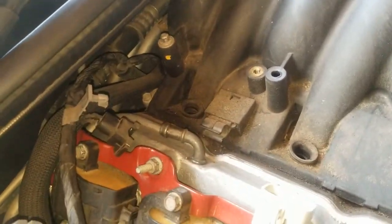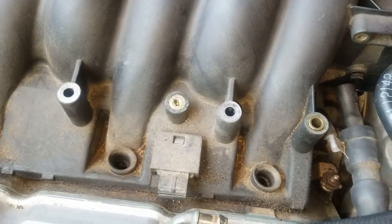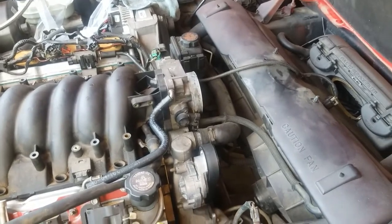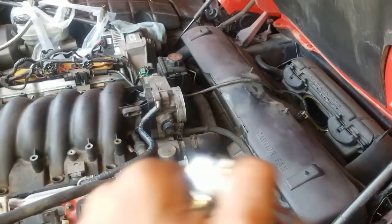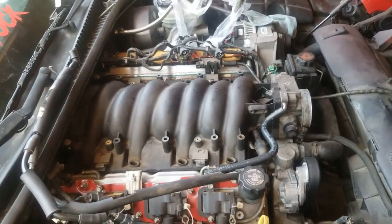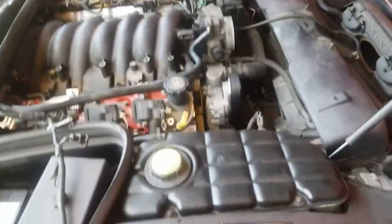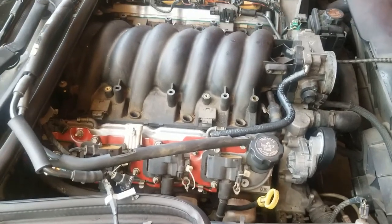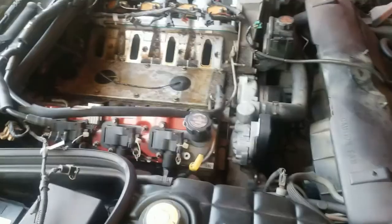Fast forward some minutes - I can't see where the new one went, and I dropped the old one back there somehow too. So it's looking like a day to take this intake off and clean it. Getting the intake off now - I still got a coolant line or something into the throttle body to get off, but I'm getting all these bolts out of the way. Our quick job turned into an all-day job, but you know, life happens. At least while this is off I can clean everything up to match the valve cover.